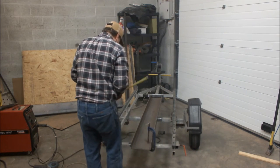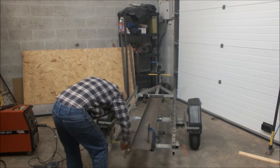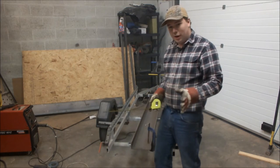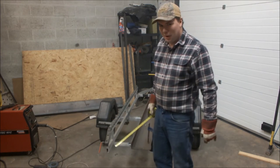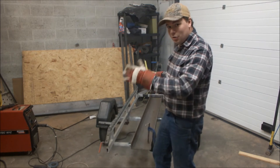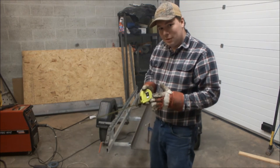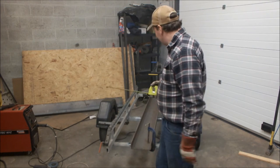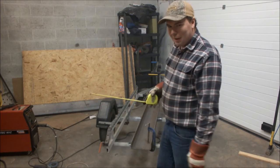Right, let's see what we've got - that's 220 to there. It has got to be in the centre, but if we're a couple of mil either way it won't hurt anybody. Even if I was making this as a two-motorcycle trailer, if it was wider, I would probably still put one ramp on its own down the middle, because you don't want all the weight over to one side of the trailer to make it off balance. But for a single one like this, as long as it's in the middle, we're alright.